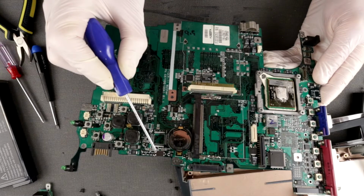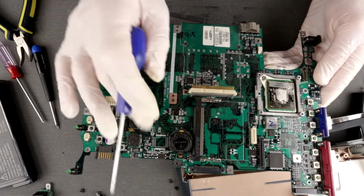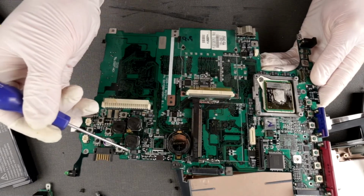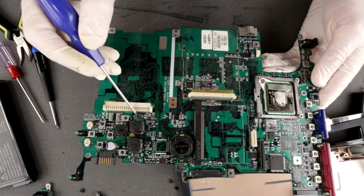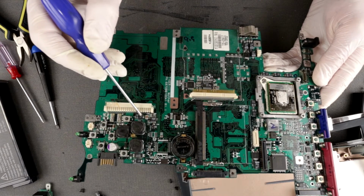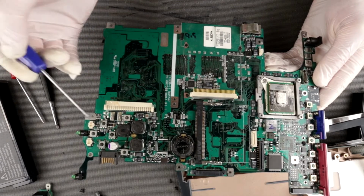Another resonator, 10 megahertz resonator, can be used. That's something more or less usable. It'd be better if it was 12 or 16 or 8. Another current shunt over here, a whole bunch of tantalum capacitors. The only problem, I don't see the voltage rating. It says 100, probably microfarad, then it says J07. Again, couldn't find any explanation what that really means.